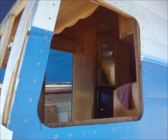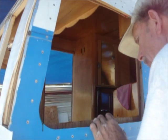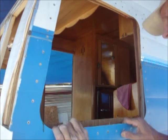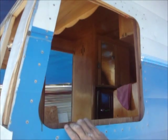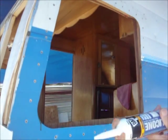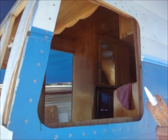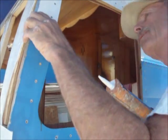Before I can actually fold the metal over there's something I've got to take care of here. This is one of the big problems that Shasta built into their trailers — they built this to leak. There's a simple fix; I don't know why they didn't bother with it, but what I do is squirt 100% silicone rubber sealant. Now I know I've told you don't use caulking for anything — that's to seal external leaks. For building purposes, that's what caulking is for: building, not fixing.